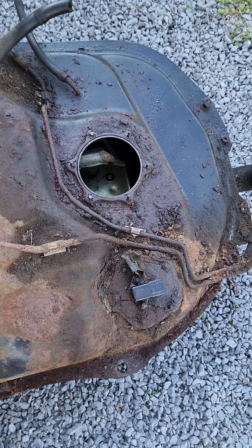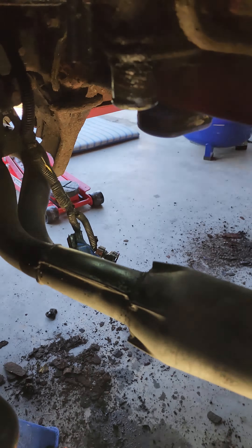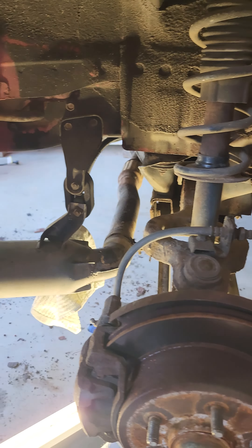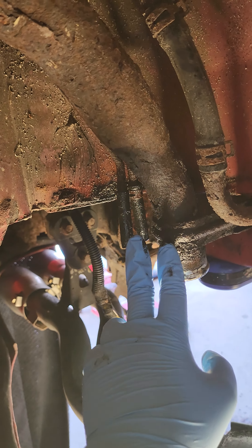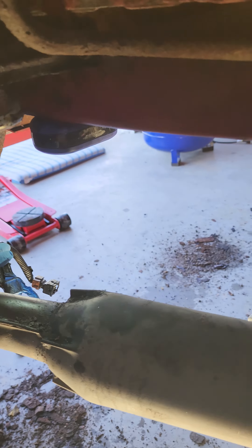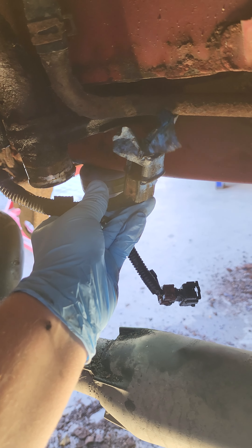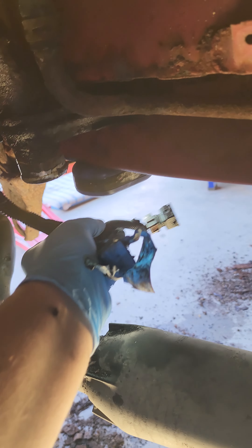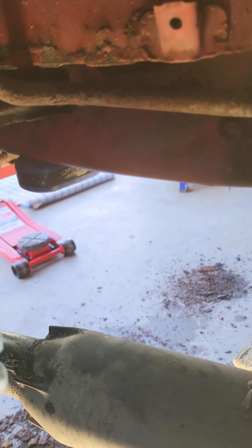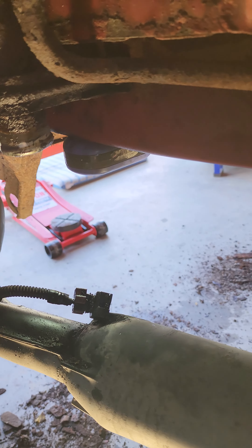On the newer versions you're also gonna have this plug. You access this plug right here — you'll see it once you pull the wheel. Here's the passenger side wheel. You're gonna have to unhook this. There are two evap lines, and here's the wire leading down — it's gonna look just like this. One you can access from the top where your auxiliary spare tire is, and the other one connects into the fuel tank. That one had a clamp I'd never seen before — there's a metal wire around it, you just pop it off and you're home free.